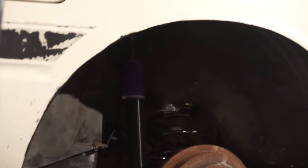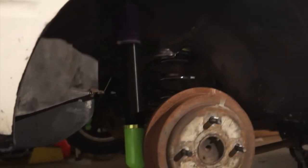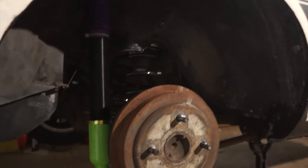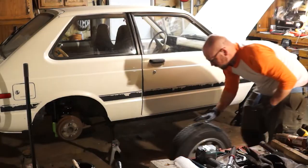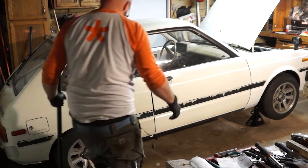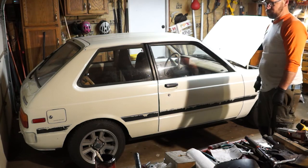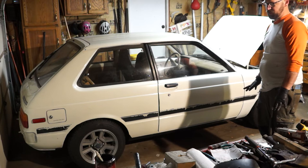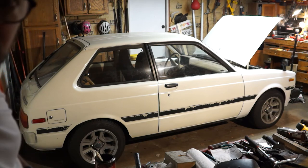So it's super late. The rear end is pretty simple compared to the front end. It just unbolts there and then up inside. You've got an adjustment on the body of the shock as well as on the spring. I've left them both pretty high and conservative at this point. We're going to put this thing down and see where it sits. I'm stoked. Definitely need to give it a drive and see what I think. Drive it for a few minutes — it feels pretty solid. I'll drive it to work. Thanks for watching. More to come. Peace.